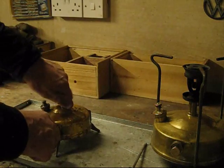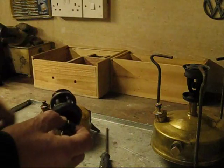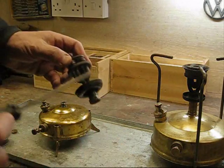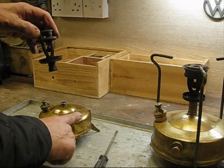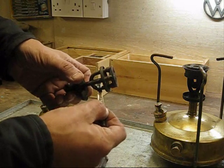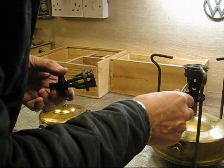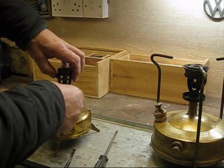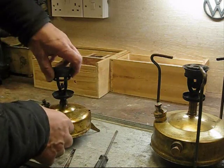There are a few different parts to these stoves and I'll show you on this one. What we have here is exactly the same — the jet is in the middle, these are the vaporising tubes that you have to get hot to enable the paraffin in the tank to vaporise. It's important that the jet is clear — you have a pricker, which is simply a tiny wire on the end of a piece of metal, and you make sure that the hole in the jet is clear. That one was burning a little bit yellow so there's probably a bit of muck in there — for next time we'll give that a clean out. This travelling stove screws on and becomes the same thing with the flame spreader on. Very very simple mechanism.